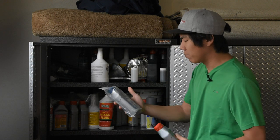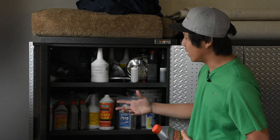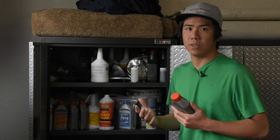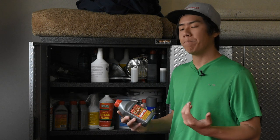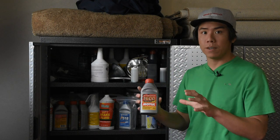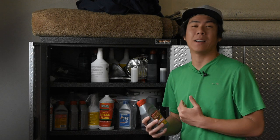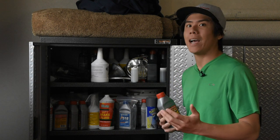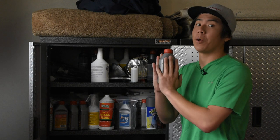There are different types and brands of brake fluid. I've got one here — a Sparta DOT 4 fluid — and its dry boiling point is 518°F. For something like a DOT 3 you might get off the shelf at O'Reilly's or AutoZone, it might be somewhere in the high 400s or low 500s. I use Motul RBF 600 in my cars — it's pretty cheap for what it is and has a boiling point of almost 600°F. They also have an RBF 660 which is higher. What I've noticed with the Motul is that you tend to have to bleed the system out at least once a year, sometimes a little more.